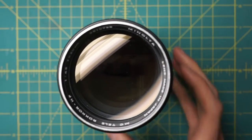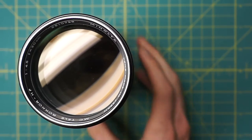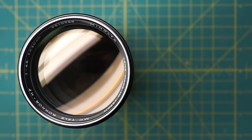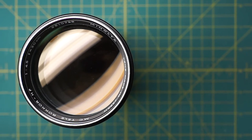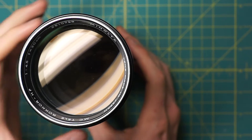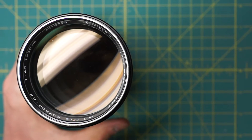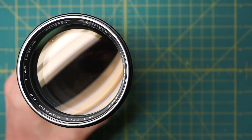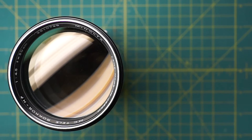I'm going to be fully disassembling this lens today, getting down to all the body sections and optics, and also disassembling the diaphragm, taking that apart, putting it back together, and cleaning it. This lens is a little more difficult to disassemble than the 135mm Minolta just because it is so much larger. It has a lot of similar design elements with the 200mm Minolta, meaning you can't easily access the diaphragm without disassembling the whole lens. Not everything locks together in a fixed position, so you have to mark how everything lines up so it fits back together correctly.